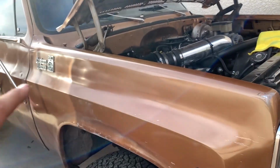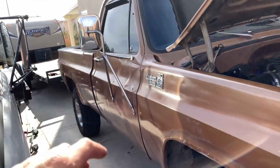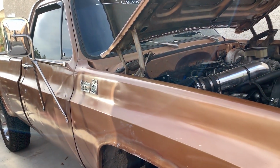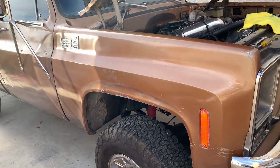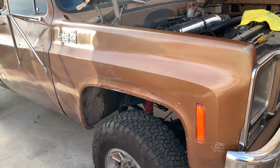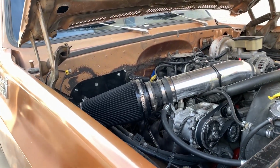So I'm gonna give you a review of how it drove. Hooked up, I got my Jeep on, 2 links on the chain. I felt like that was plenty of pressure, and it drove good. I think it drives better towing the trailer with the weight distribution hitch on here than actually by itself. Probably let the air out of the tires and it might drive a little bit better, but it was a lot less correcting. Everything stayed true and straight.